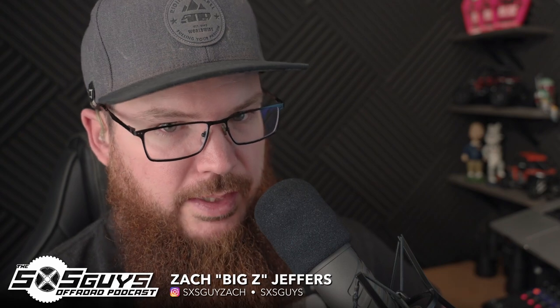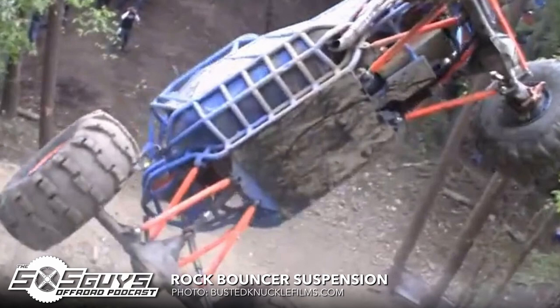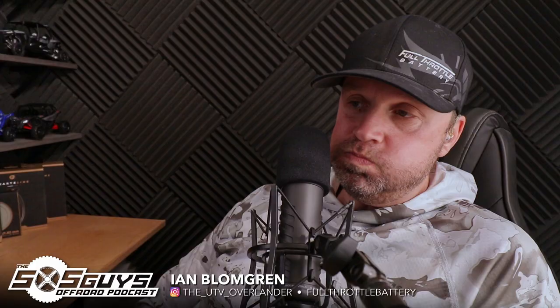Someone was commenting in the forums about the dual shock setup — from the factory it doesn't mean they have to include dual shocks; they can just have eyelets on the arms or mounting points to accommodate dual shocks and plan from the beginning. On the solid axle, somebody was pointing out the second arm: if you look at the flex diagrams those are just the attachment points — the arms that attach the solid axle body to the frame. Usually two points of connection, at the center and outside, so the axles rotate on one central point but can go up and down freely. The solid axle design puts the diff on the arm, and the big boxed I-beam setup they have is a lot of material — not just factory radius rod metal.